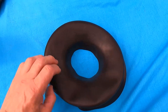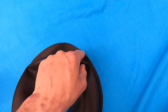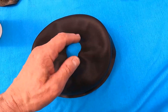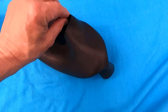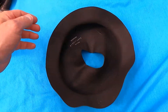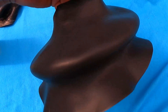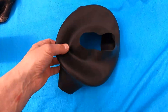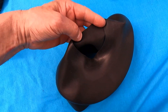This is the new bellows neck seal — called 'bellows' because it looks like a bellows. Because this is an internal seal, we have to clean this face with toluene before we start the glueing process. Contour neck seals are just shaped neck seals; the idea of the bellows design is it gives you more flexibility when you're moving your neck without cracking the seal around the edge. They come in three different sizes: small, standard, and large.